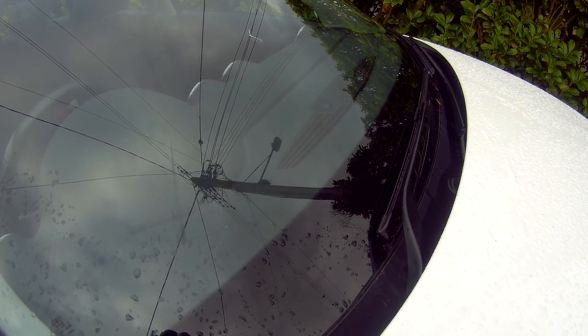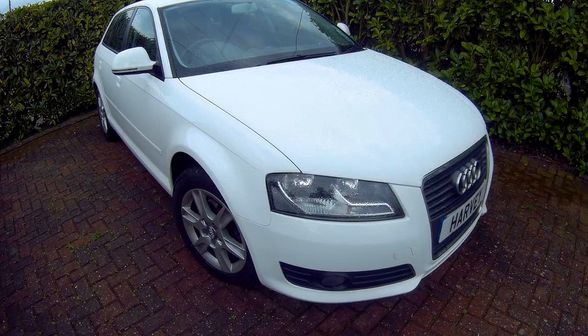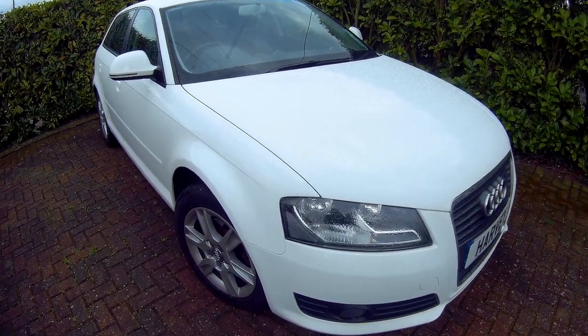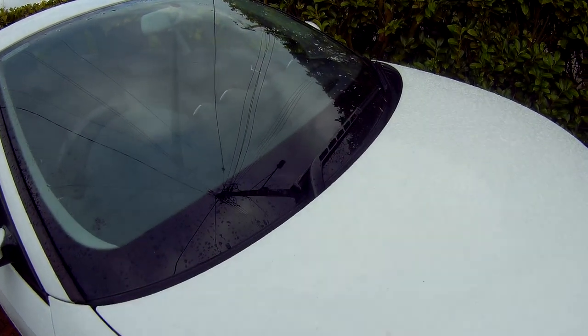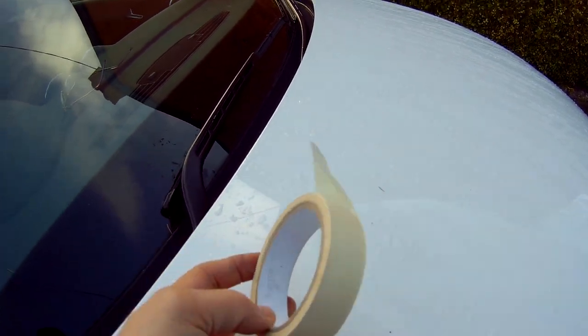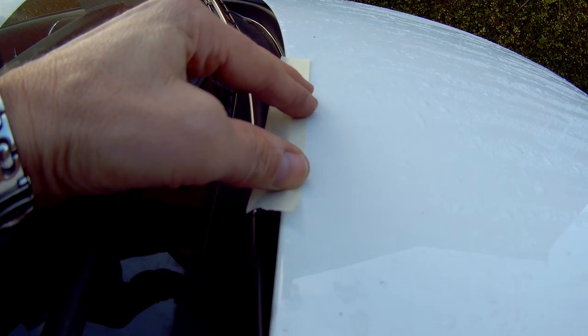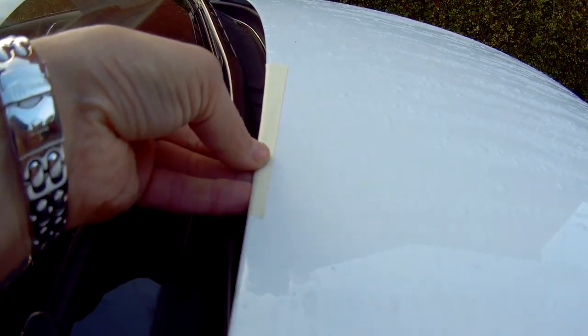And that's all there is to it. Although I must stress, if you take them off too quickly they've got a tendency to just fall out of your hands, so take care to hold onto the wipers. Because of the danger to the glass if you knock them, and the difficult stretch if you're taking the wipers off close to the glass in the service position, you can actually change the wipers on this car with the bonnet closed in the wipers' resting position. You just need a couple of strips of protective tape on the painted edge of the bonnet for each wiper. And as I will show you, the wipers can actually be taken on and off with a little bit of care in their original resting position.